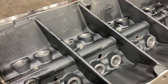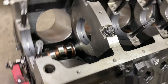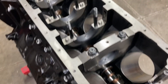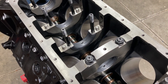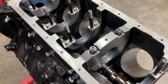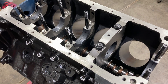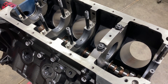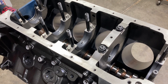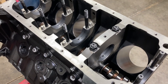I'm going to spin this over. This block has already been washed and cleaned. What I do is block off the passages, and after it's jet washed, I run some pressure-fed lacquer thinner through the galleries to make sure everything's clean. It's a noticeable difference — when you do that, you'll see a little bit of dirty lacquer thinner come out at first, but afterwards you know it's clean. Even after the bores have been scrubbed with a brush, there's still some stuff left over that needs to be cleaned out. That's how I usually do it.